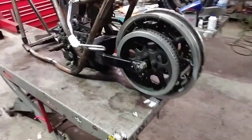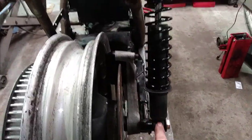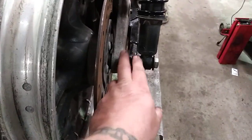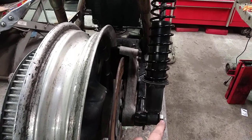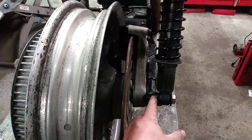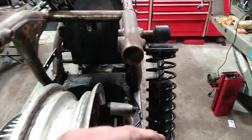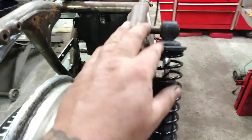Nobody asked about this, but I'll just let this go. Up here it's tight — you can see what's going on. This is pretty wide, and some people grind it down and make it narrower to bring the shock in. This area is also threaded — it's a half-inch coarse thread bolt — so you can drill it out like a regular tab on a swing arm and move the shock in a little bit, then just put a nut on the back side, which brings it in. I usually just leave it because it's threaded, it's nice, and it's already done — one less thing to worry about. I always get rid of these though; I drill them from the back side and cut them off.